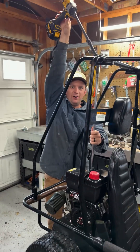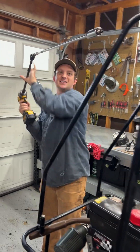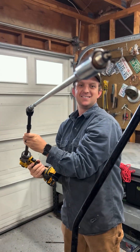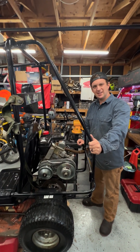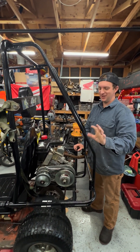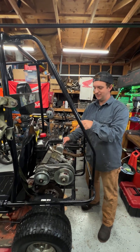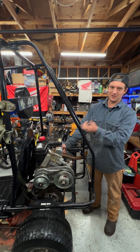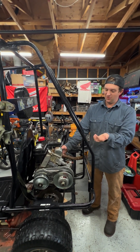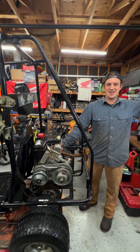There's something rotten in Denmark. After you've yanked it, we're going to check the spark plug. Take a look at that. Well, we're about 30 seconds into this project and we already have some grave concerns. We don't have basically any compression. We can't see the piston wiggling around there, but we're going to check for spark and then go from there. We haven't checked for the oil - that's usually like step 10.